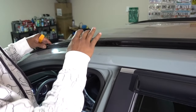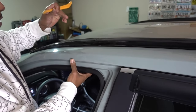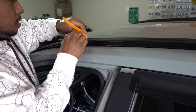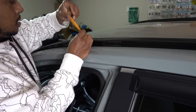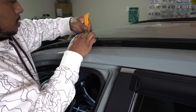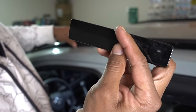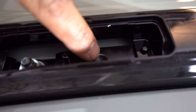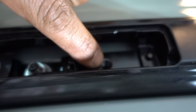Now here on the top of your roof, I have a tool to remove panels. I have the covers in here — there's a little cutout on the inside. Just put your tool to remove it; that's the little cutout. You've got to remove it on all four corners. Here with the cover being removed, this is the hole where you're going to put the screw on your new crossbars.